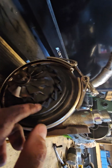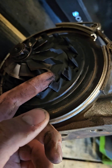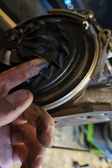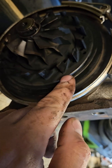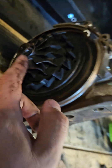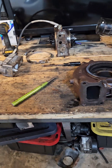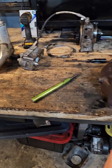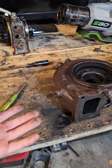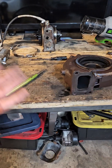This feels significantly lighter and more straightforward. The vanes having the correct geometry — always pointing at the fins at the perfect angle rather than swinging in and out through holes like on the Borg Warner or even Garrett designs — I think having this exact angle but closed down will spool this quicker. I didn't want to buy a brand new turbo, but if this does what I want and I get about 10 to 12 PSI by 2000 RPM, I'm happy.